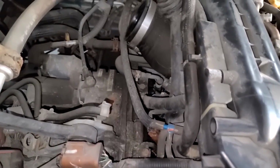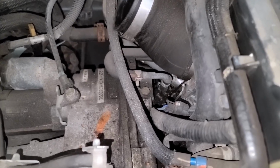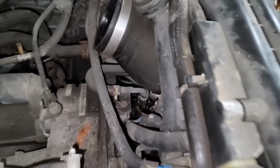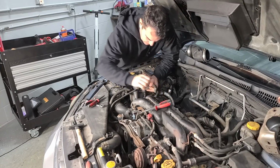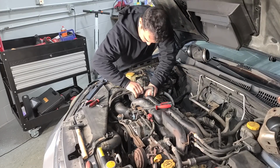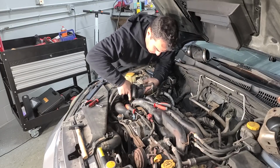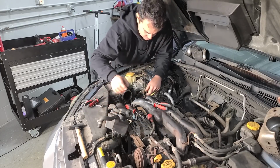So we begin to go down the inevitable rabbit hole of while-you're-in-there Subaru repairs. And what is this stuff here? Okay, kind of looks like we literally had a rabbit living under this intake. So yeah, we need to take it off. All right, so I've sucked out all the coolant from this reservoir. So I just disconnected one of the hoses on the bottom here, and we'll get this out of the way. Okay, there we go. That is gone.